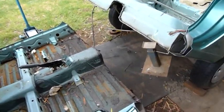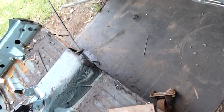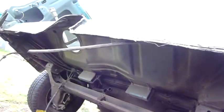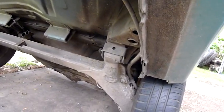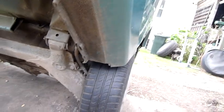Well, that's how you do that. That's half a car. As you can see, all the cross sections and the stand that I wedged between it to get it far enough apart, and just cut the park brake cables. I probably could have used them, but I wasn't going to be bothered climbing under here trying to unscrew all those rusty old screws. I just cut them all off, punch those bolts out of the subframe mounts, the beam axle mounts, and drop the axle out of it.